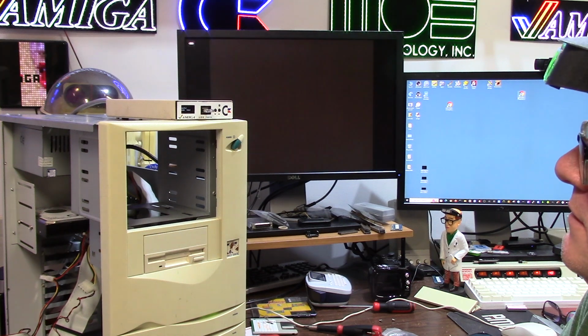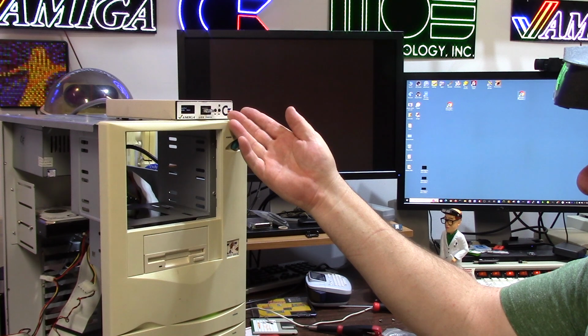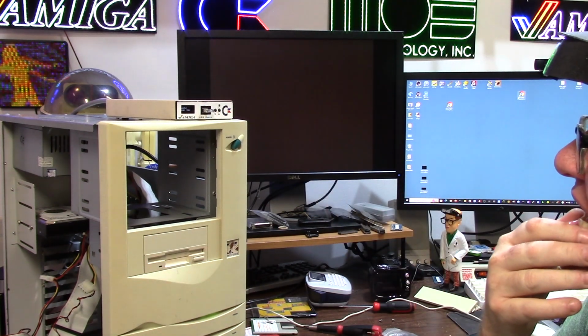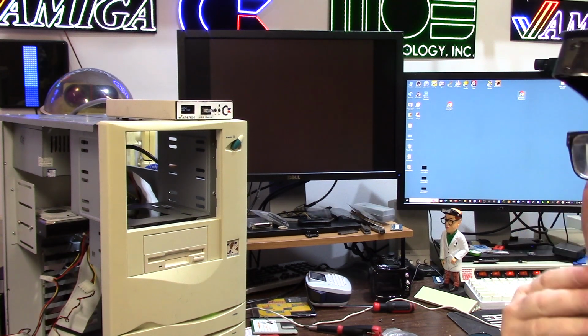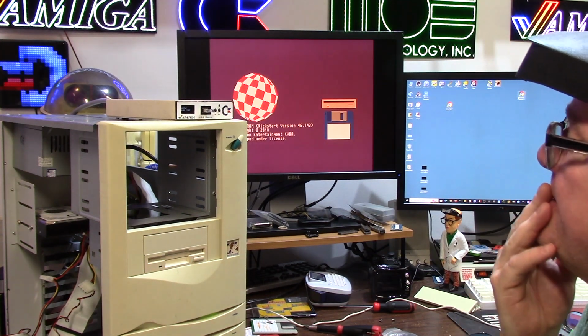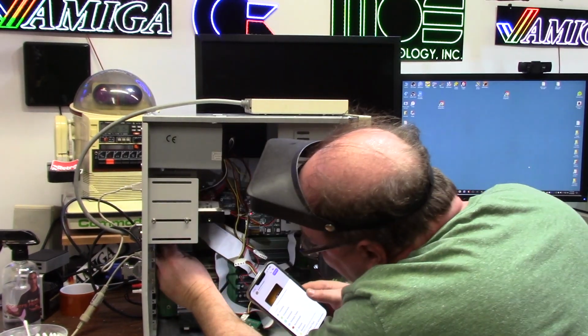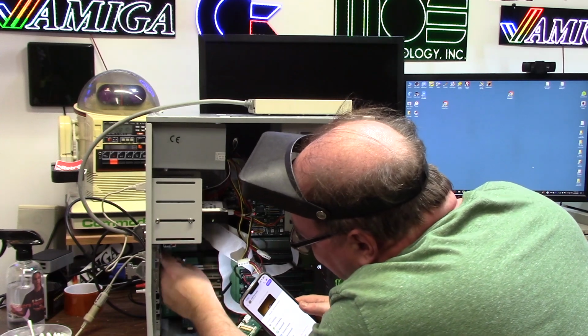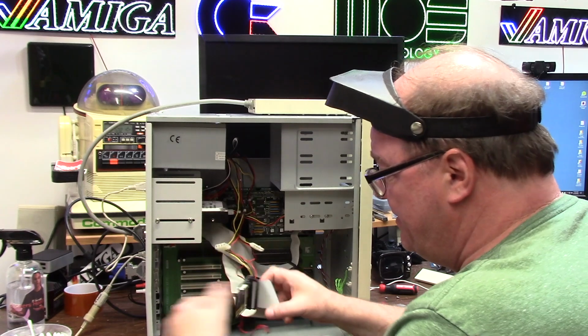Does it work? Install 3.2 is in the drive. I think my jumper is still set for DF0 is external and I have to take this thing apart. Yep, be back. Okay, so I managed to reach my hand up in there and put DF0 back on. I had to unplug the P connector from the Elbox riser board.